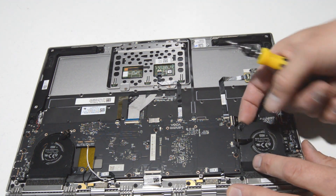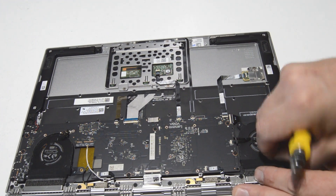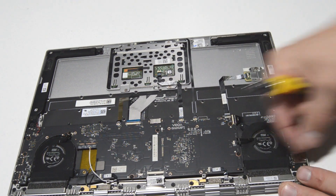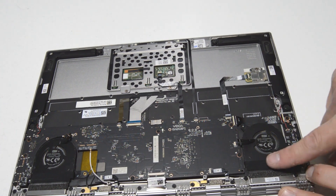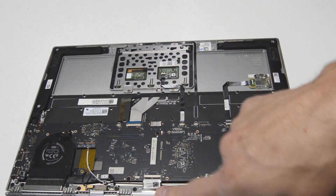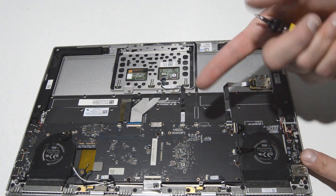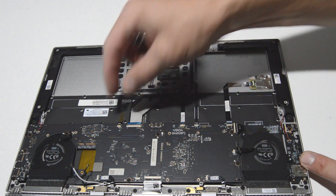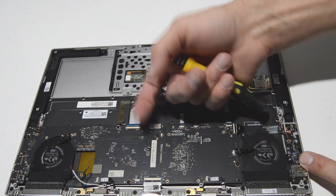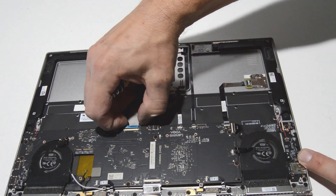There's a little bit of tape here connecting the fans and the heat sink. I'm going to leave it for now, but peeling this tape back will allow you to replace the fan without removing the heat sink first. We'll go ahead and finish removing the motherboard now — just flip up these little connectors and remove the ribbon. Always flip those retainers back down so they don't get broken.